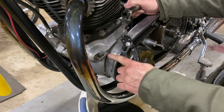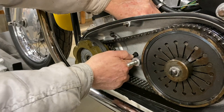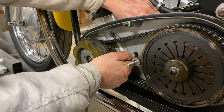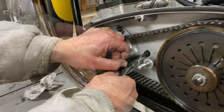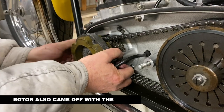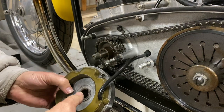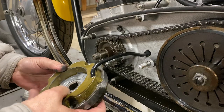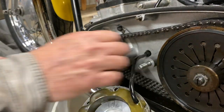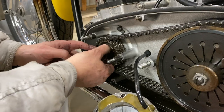There we go. Maybe I glued it on. There's no way to just pull that through. It feels like it's very tight — you just have to be real careful. You don't put too much stress on that because that's where it'll break. There we go, that should get it off. I usually just cable tie it up so we don't lose it. And let's take that off — that's the Woodruff key there coming out, and the spacer.